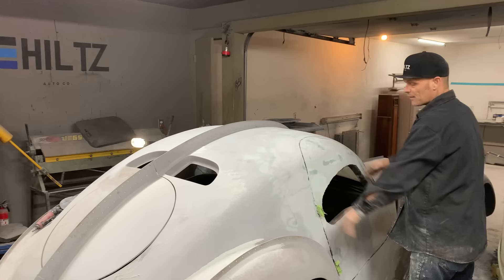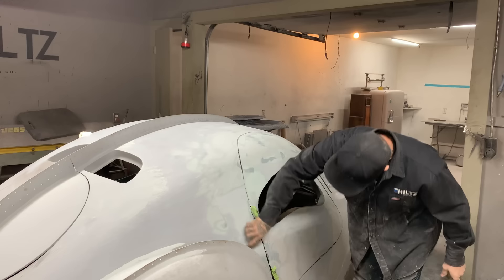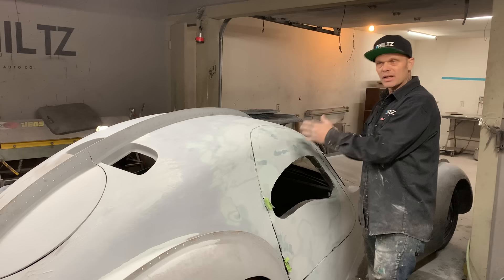What I've done is come in and knocked off all the little boogies - what I mean by boogies is little rough spots that you can't smooth over nice. I roughed it off real quick, then I went and mixed filler and put it on the roof and on the door all the way around, as you can see. And what has happened is what I call flooding the area where the door is.